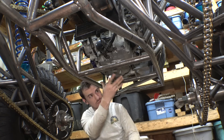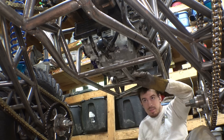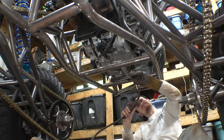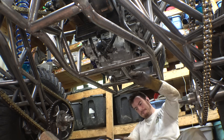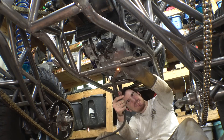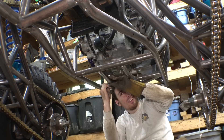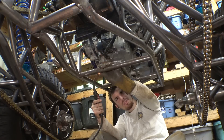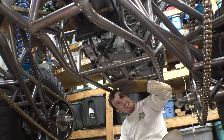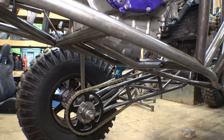We really want to make sure to protect the oil pan, so I cut these out. I can't wear my hood under here, so I'm just going to have to close my eyes and tack each in place. This is challenging — definitely not the best tacks ever, but for not being able to see, not that bad. This should be able to protect the oil pan a lot better because it's kind of level with the bottom of the frame.